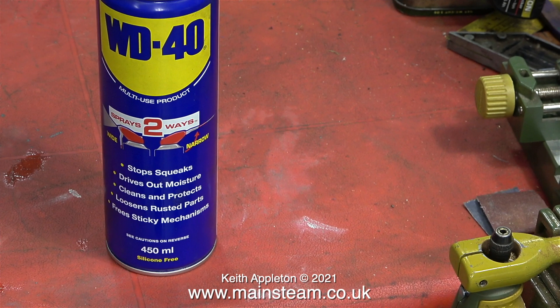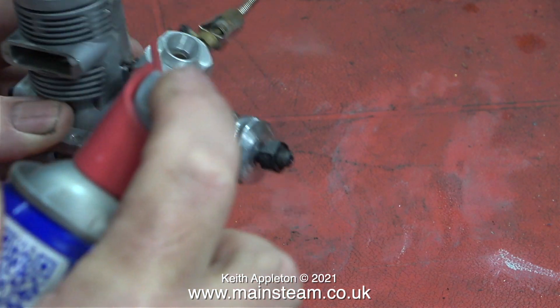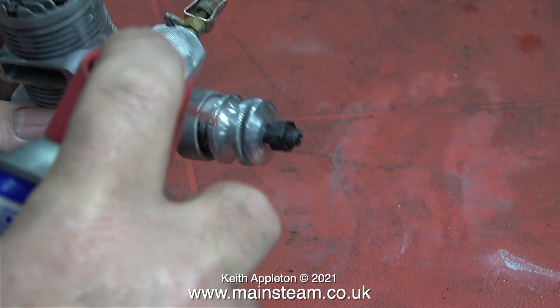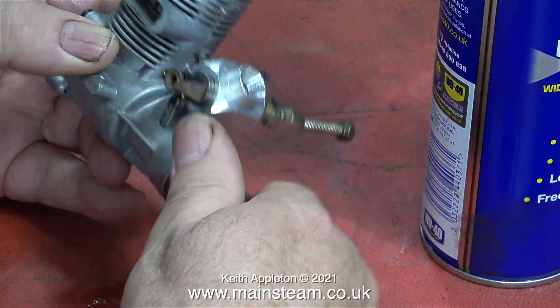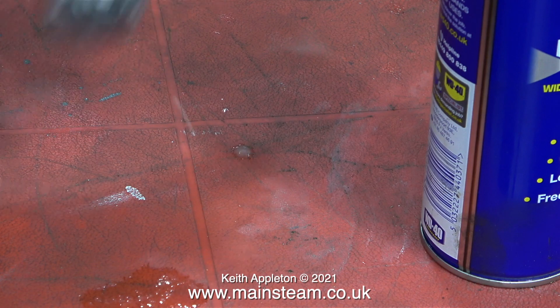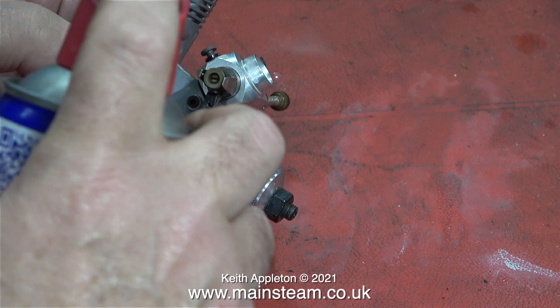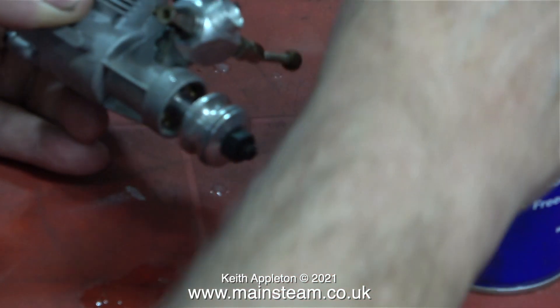Time now to go into the workshop. This of course is WD-40 and I'm going to spray all of the engines thoroughly with this and also add some lubricating oil. I'm really impressed at the state of the aluminium — because ultrasonic cleaning is non-abrasive, the crankcase looks just about the same as it did when the engine was new. Here I'm shaking the engine and you can see one or two water droplets coming out, but a further application of WD-40 chased all the water away.